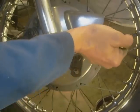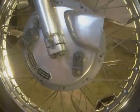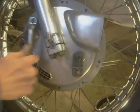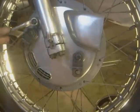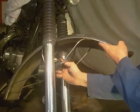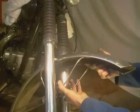Crack off the spindle nuts and the torque arm bracket nut bolt thing. Right, I've got the front wheel out. Now whip the front mudguard off — four bolts, one to each fork leg. In my case these are 7/16 spanner size. Four bolts out, mudguard off.